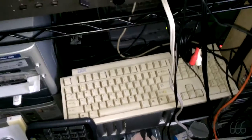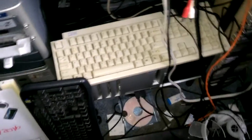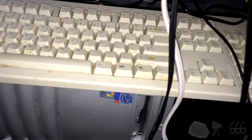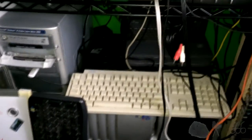So that's what I'm doing now. I'm going to recover all of that data and then go find a drive to replace the failing one. I have to take all this stuff out of here — most of it's easy enough, but the computer sitting on top might be a little difficult. Fortunately, it's not a BTX system, so I can just pull the cover and replace the drive in place without pulling the whole computer out. We'll see what I can dig up in my parts bin.